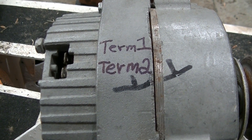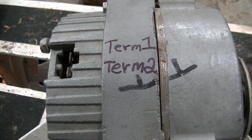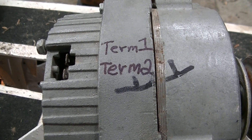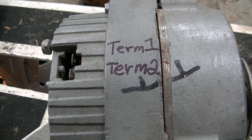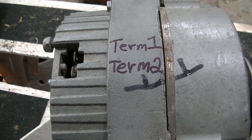Then it stays charging after that point. The difficulty is if you've just started up and you're warming the unit up — you don't want to rev the heck out of it to get it to the point where the alternator cuts in — then you're really not charging the system for a period of time.